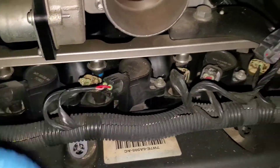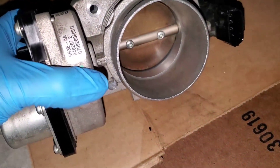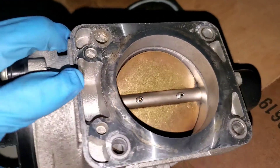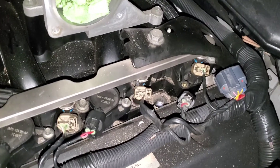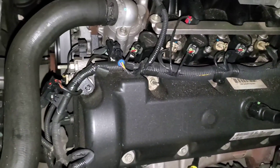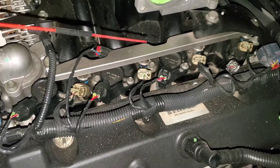The throttle body looks like it has four bolts. Quick update: I have cleaned out the throttle body and it looks nice and clean — it was pretty gunked up pretty bad, so I'm very pleased with the result. I've already done three spark plugs on the driver's side, and there was a ton of dirt and debris. It's very important to blow out all the debris from the spark plug hole so you don't get that stuff into the engine.